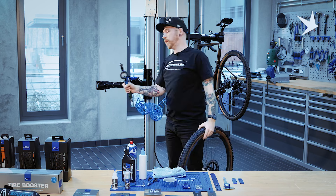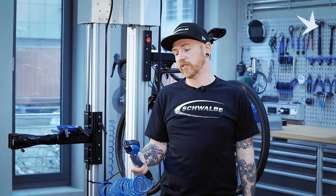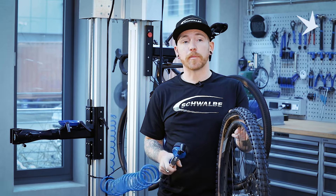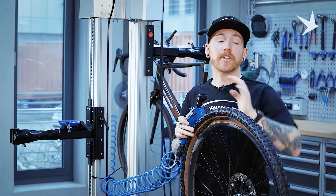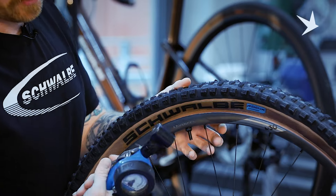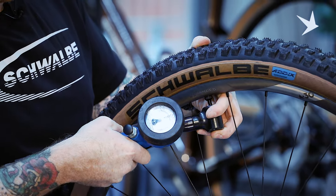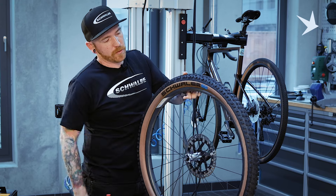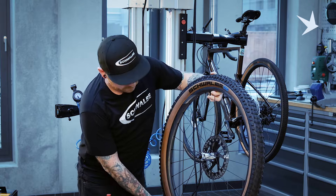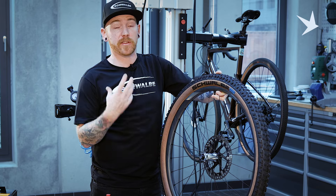In this workshop, we're fortunate we have a compressor. This makes life pretty easy. It gives a good flow of air when setting up tubeless. However, I'm pretty confident with all my tubeless setups that I will be able to use just a standard track pump as well, because the tyre has got quite a nice snug fit. It should just inflate with a track pump. We can see the pressure gauge, the head of the compressor, pop it onto the valve, make sure we're holding the wheel tight. Inflate, not too hard, and then just hold our finger over the valve, check that the tyre is inflated correctly.